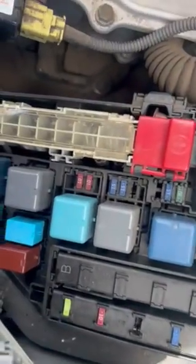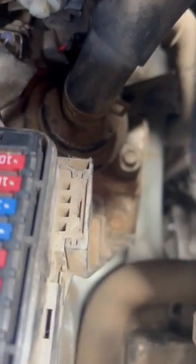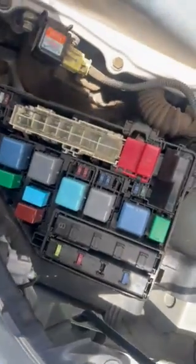What I'm finding is a common issue: these inverter water pumps are shorting out. What you want to do is unplug that water pump and put a new fuse in that AM2 fuse slot and see if it blows.